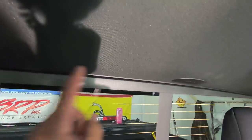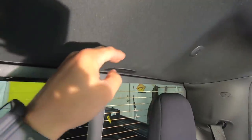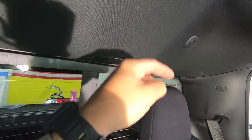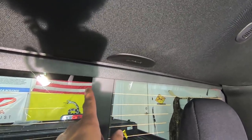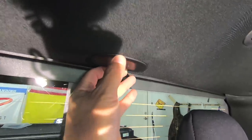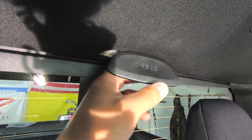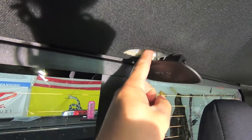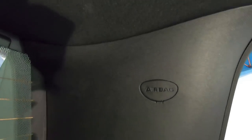We need to get that wire from the third brake light down the C-pillar, so we need access to fish wire through there. To do that, we need to drop the headliner just a little bit — it's a super easy process. First, on each side of your rear window or behind the rear headrest, there are small plastic pieces; just grab those and they drop straight down — they're just clips concealing a Torx T20 screw. Then there's another T20 screw on the inside as well.